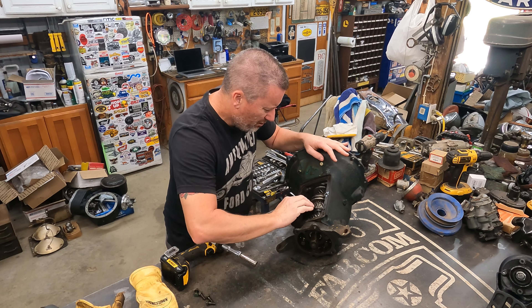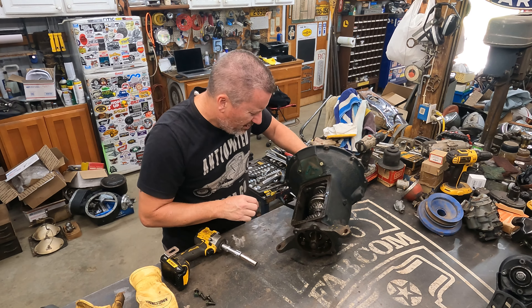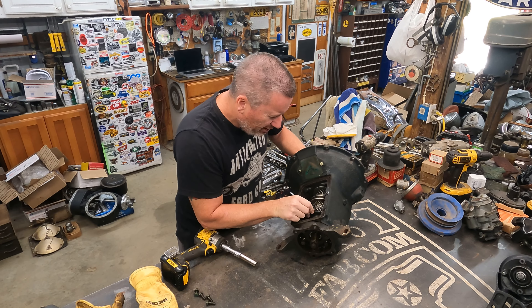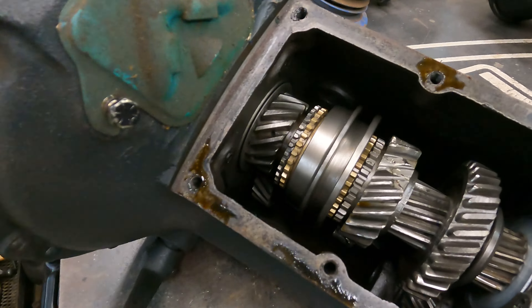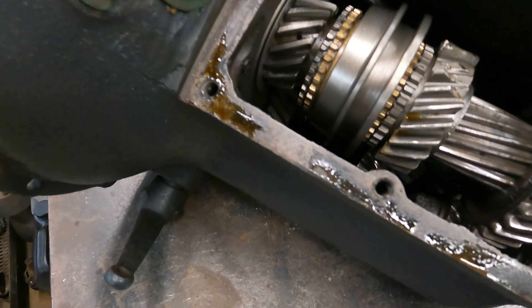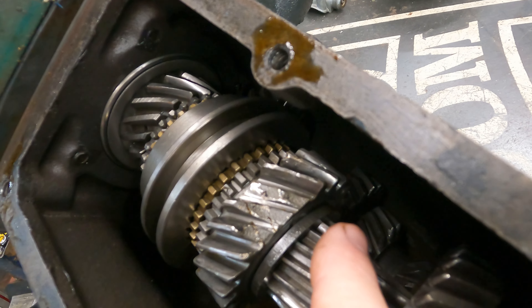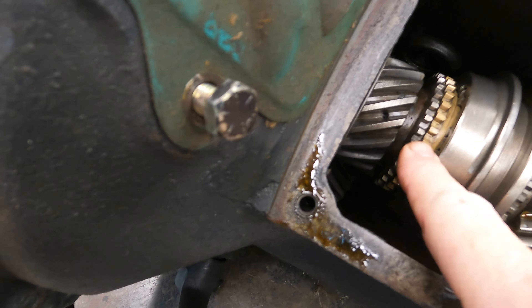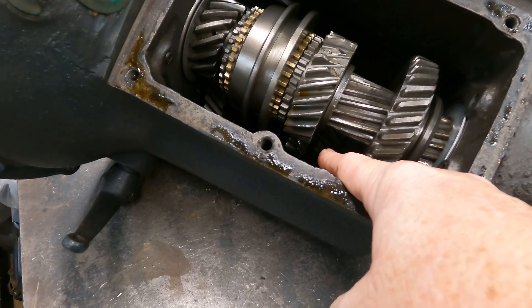She's locked up right now. Everything looks new in here except that one gear is just jank. You can see that one right there got slammed — it's not turning now because the bottom has some busted teeth too, and I can see on the top there's one missing. So we're going to pull this apart, replace that gear, and look at all the other stuff. I think everything else is good since it had been completely rebuilt. We'll swap out that lower cluster and put it all back together.